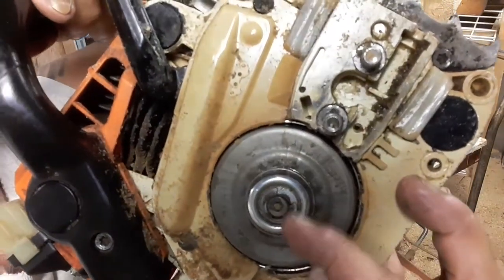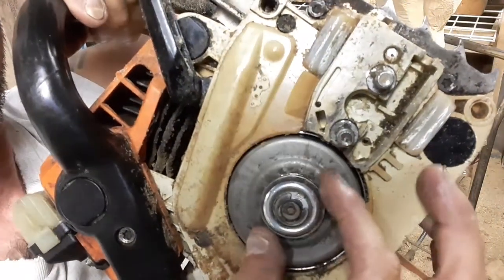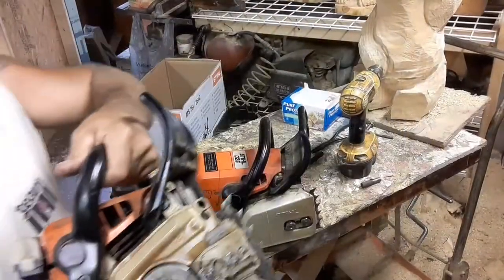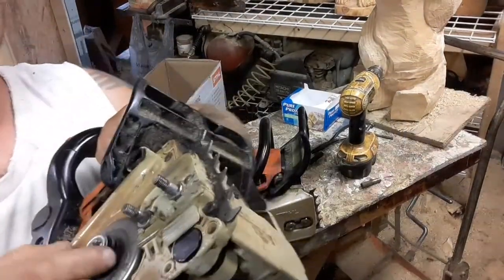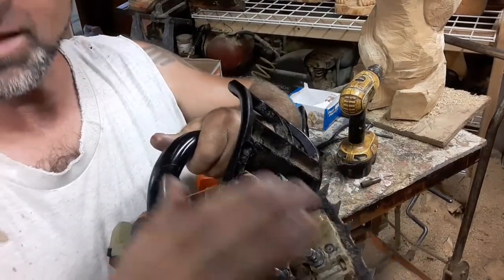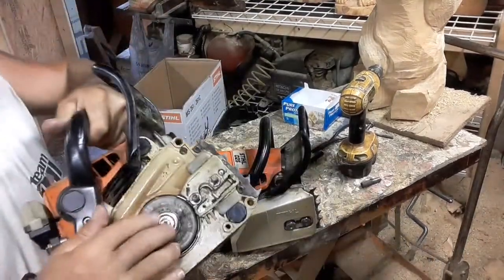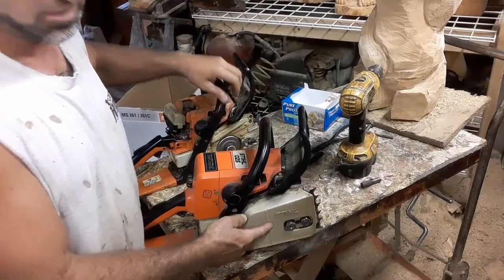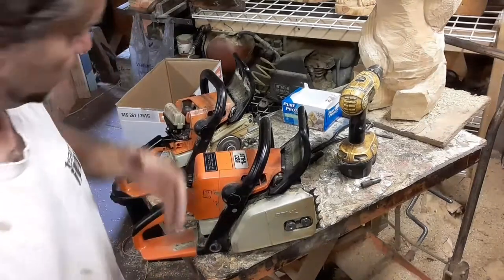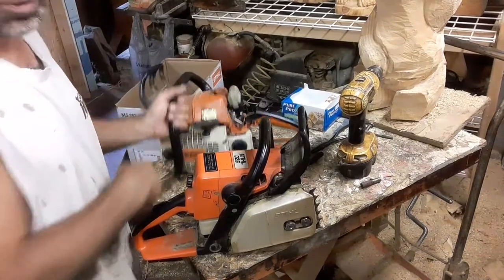If this little clip, the little C-clip right there on your shaft, falls off, and the only thing holding your bar and chain, or holding your chain on the sprocket, or holding your rim on the hub, is the outside cover, as that's banging in and out, hitting the inside of the cover, that's going to cause vibration. There's so many things on these saws, but number one thing to check, always pull your pull starter off